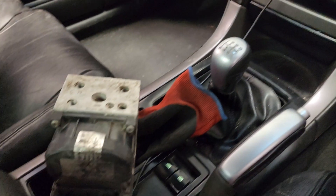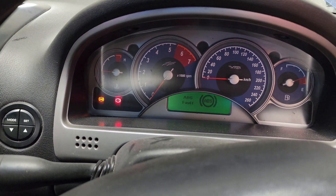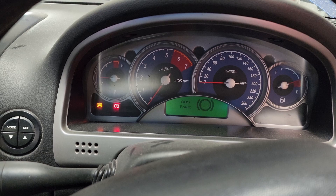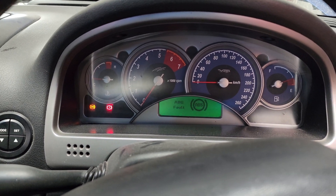So all we have to do is go under the bonnet, just to confirm a thousand percent before we actually install this, make sure this one's working. Just sit it in there, plug it in, let's come back over here. We won't need to clear the codes, I don't think. We'll just turn the key on and if it recognises that it's getting communication back to those modules, then the light won't come back on. So let's test the theory out.